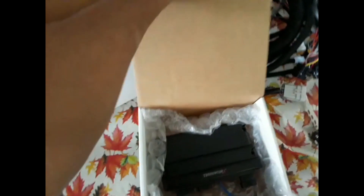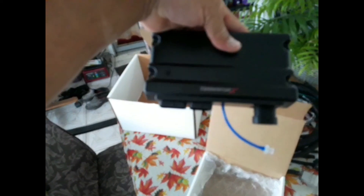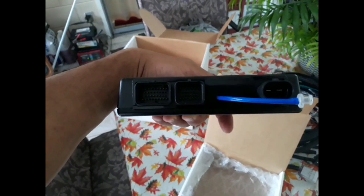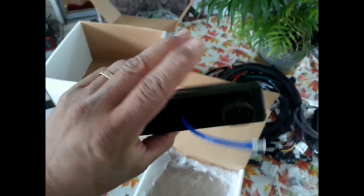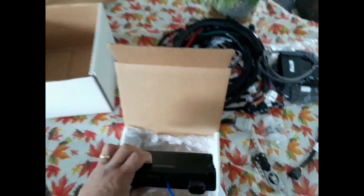And here is my computer. The only thing I'm thinking it's missing — you guys don't understand how excited I am about this. No more VATS. There you go, beautiful. No more VATS. And this little line right here is basically the MAP sensor. I'm not going to use the stock one. I'm actually going to plug this into the intake and we should be good to go because it's got a built-in MAP sensor. It's supposed to be plug and play — that's the goal. All the necessary hardware for me to get my vehicle running.